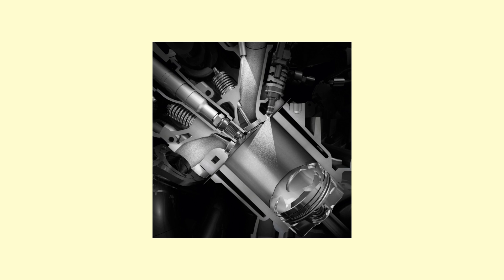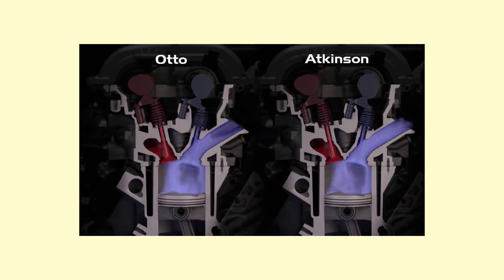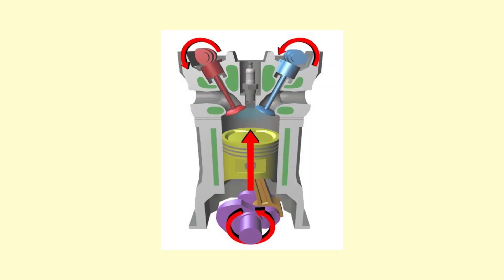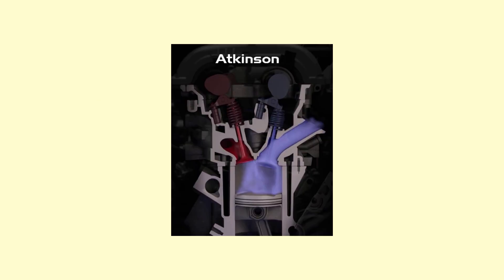The spray shape from the direct injectors was also improved for the IS500, with new spark plugs introduced as well. But there's a very interesting new feature: the ability to switch on Atkinson cycle at legal speeds for better fuel economy. An Otto cycle is pretty much the piston going all the way down and up normally, with a spark plug making an explosion that pushes the piston back down. The overwhelming majority of engines use this cycle, where the piston travels the same distance going up or down — meaning great power, but not as much fuel economy.